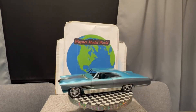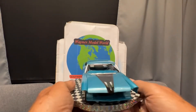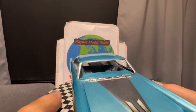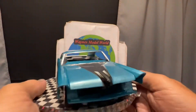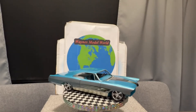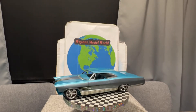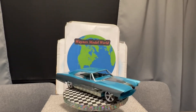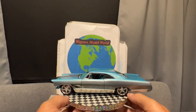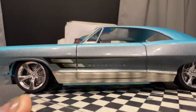The clear coat is Rustoleum 2X clear. I just cleared this this afternoon, so this is basically how it came out of the booth — I haven't done any sanding or rubbing on it yet. We put a decal on the hood that matches the one down the side. They come with a custom front end, but I didn't like the way it looked — the hood was big and bulky — so I'm going with the standard factory front end with the bumper and grillwork.